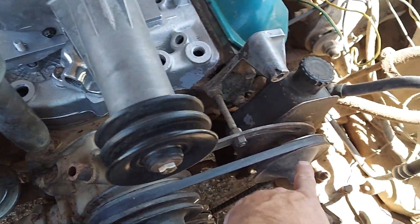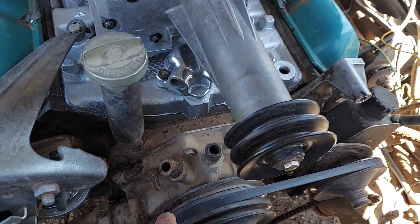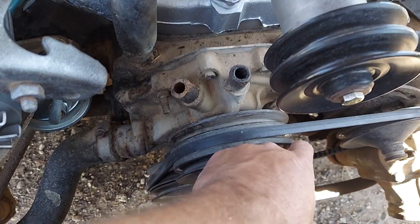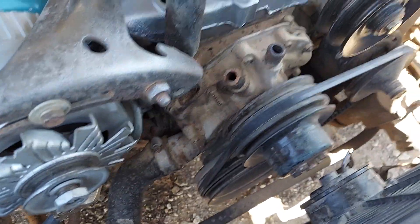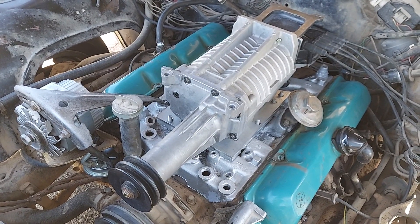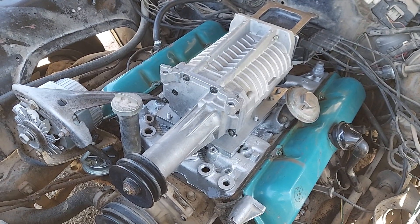The middle pulley — I'll run it from the power steering pump up to this groove here and then down to the crank. For this third groove here, I'll just get a small belt and stretch it on there to make sure the water pump gets the traction it needs to spin. Let me go ahead and show you what I'm talking about when you need to modify this supercharger for this application.